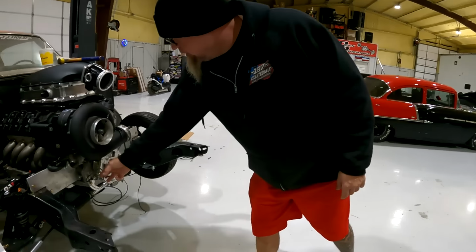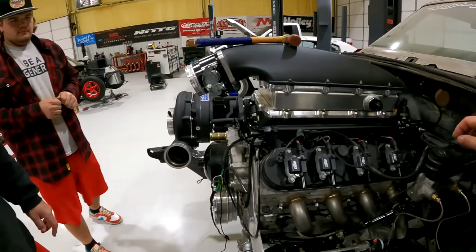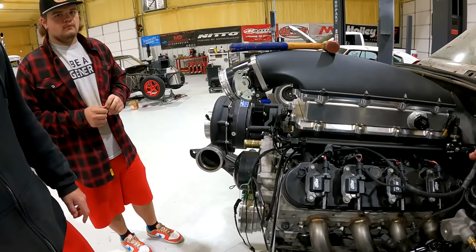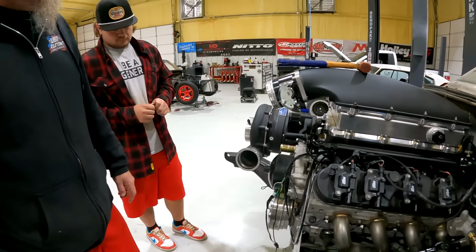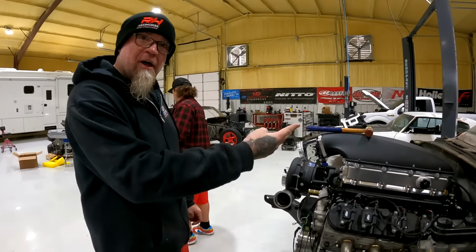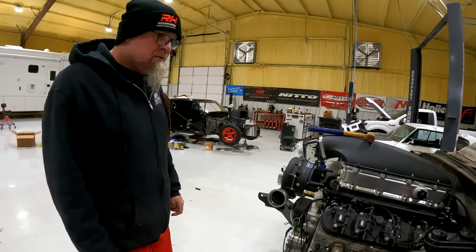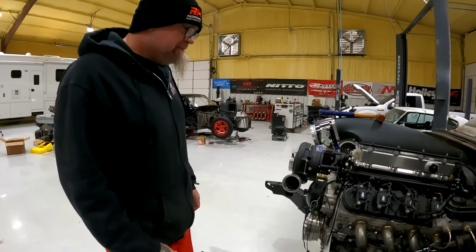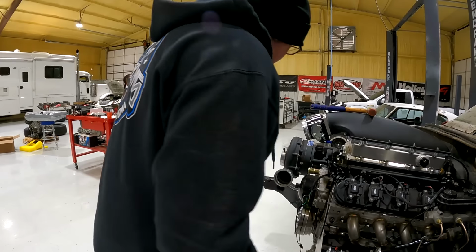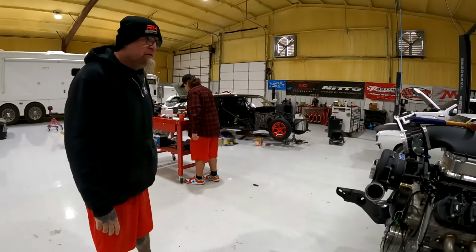You still have a little bit of. Yeah, I can do that from underneath. This one here won't be too bad. I just gotta figure out what's what. Like the purple wire is the one that actually drives the injector. The reds are just powers, so no big deal. The only thing is figuring out what is what. We can just plug the ECU in and should be able to fire the injector and tell me which one is which. Other than that, we can put the front end on it, wire all that up, and then get the radiator and everything lined out while me and you work on this over here.